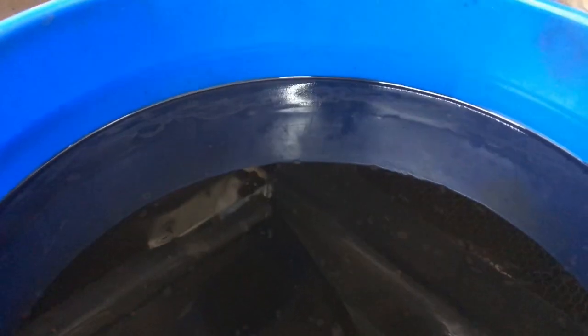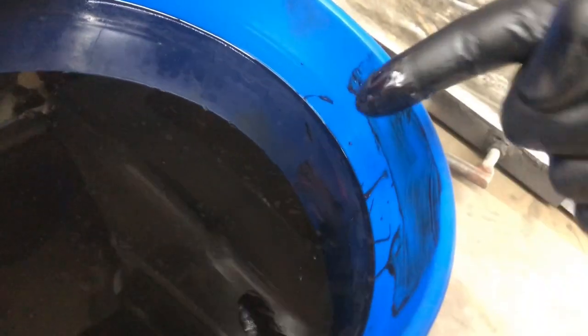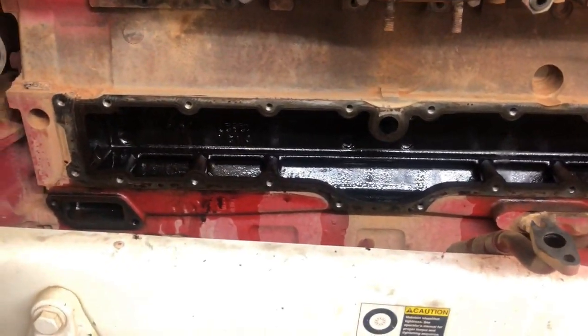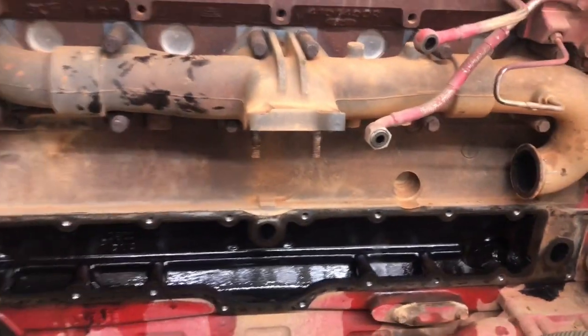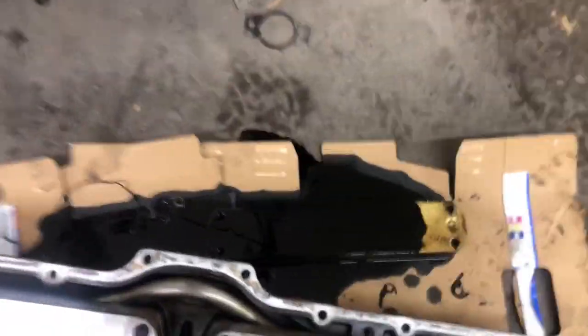This is supposed to be coolant — just so you guys know, this truck had red coolant. So what we've established is we got that off. Here's the culprit, that's where it goes. Oil cooler — you guys can see — you gotta take the turbo off, take the EGR cooler off, remove all the pipes and stuff, and here's what we're talking about.